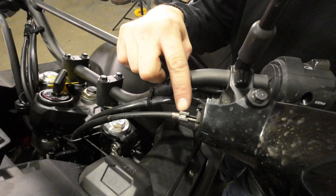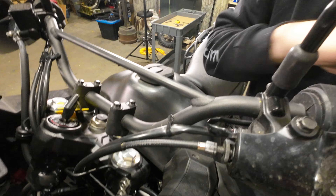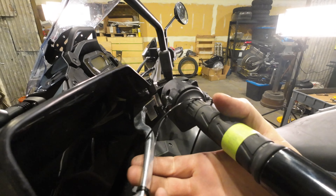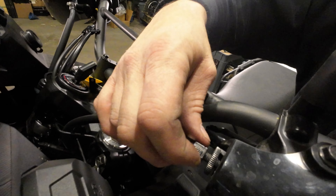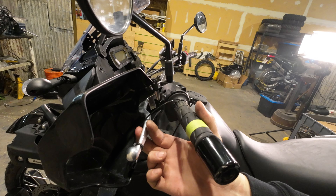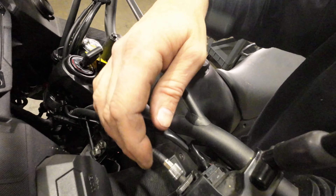This is your cable adjuster at the bars — this is the second place you can adjust your free play. There's a lock ring on the outside; turn that counterclockwise and then you can turn the adjuster in and out to get the amount of free play you want. With no free play there's no give at all when you pull the lever. Turn this clockwise and you start to get free play. I like to run mine with a little bit more than most people — at the end of the lever we're probably 12 or 13 millimeters between all the way out and where it starts to bite, which is a real safe number. Come back up and lock that.